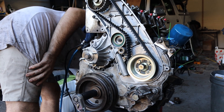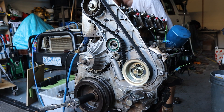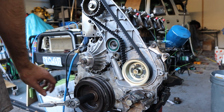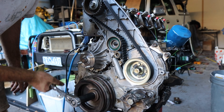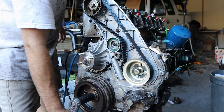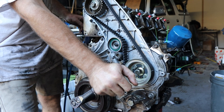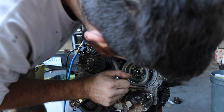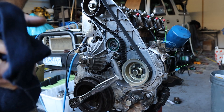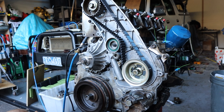That's okay — I've hit the engine stand at the back with a flywheel bolt. There we go. Our timing marks line back up again, so that means we've done it right. Might as well tighten that crank pulley and then put the rocker cover on.